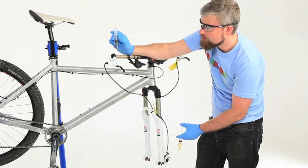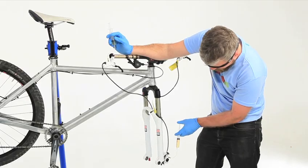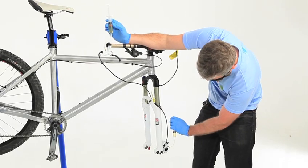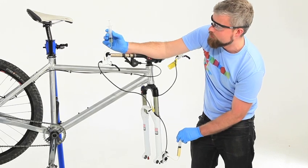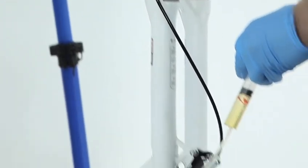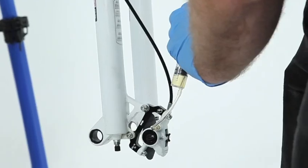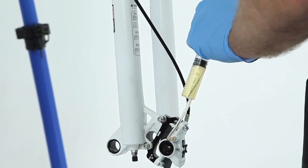With the syringes positioned so that any air floats to the top of each syringe and doesn't enter the system — that's the whole point of the bleed process — we're going to push fluid through from the caliper up towards the brake lever. Always keep the level above 5mm. The next stage is to pull up on the caliper syringe to suck any air out of the caliper. You'll see the fluid level drop in the lever syringe, so again don't go past 5mm. Repeat this process — pushing down on the plunger, pulling up and pushing down on the other to pass the fluid through the system.